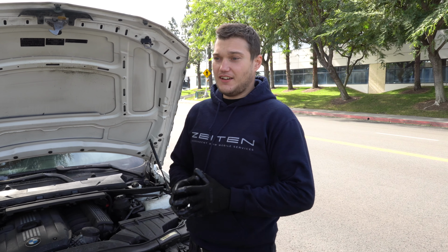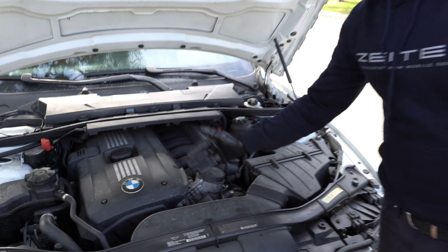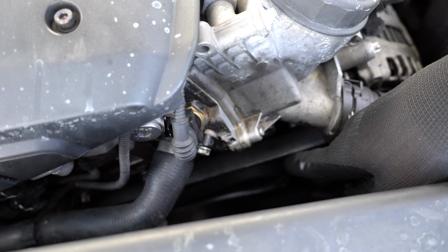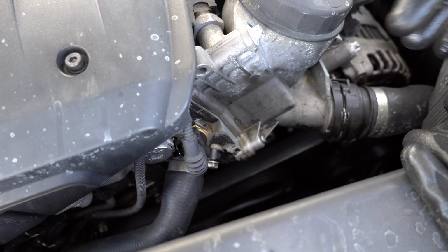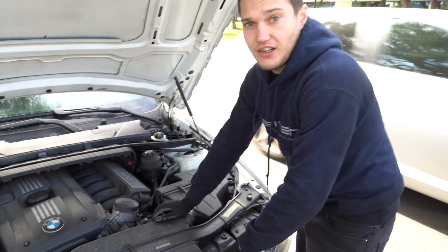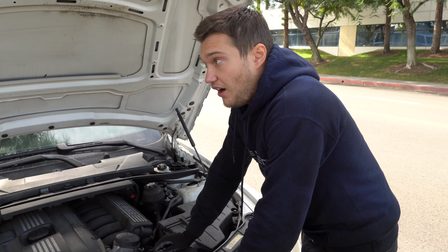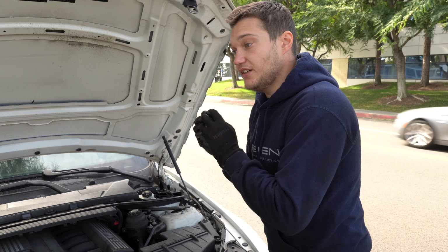So what this leak is capable of doing, the damage it can cause. First of all, it leaks directly down to the tensioner right there and the belt, so the belt can become slippery and snap off. The worst case scenario is the belt catching there and getting shredded, and it can get sucked into the engine, blocking the oil pump intake tube. When it does that, you will have the low oil pressure warning, and you basically cannot drive the car, that's for sure.